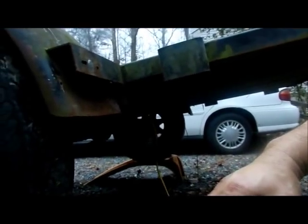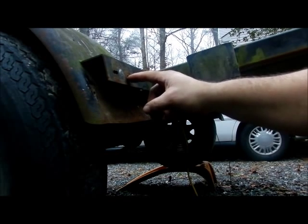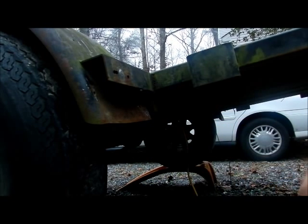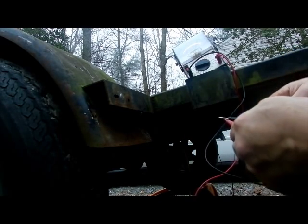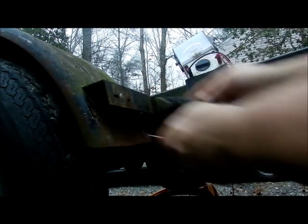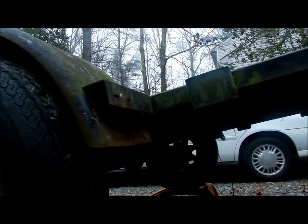I'm going to go ahead and file my hole up here. These two holes are where it's going to go — you can tell this has already been drilled once. I'm going to file it to where I can see bare metal so when I hook up this ground it's going to hit metal. I have continuity up there — you can see it bouncing. I put this to ground, this to ground, and I have good ground in there. I roughed it up in there and got good ground. It needs a 7/16th wrench.